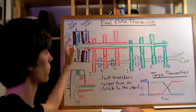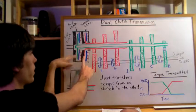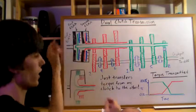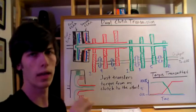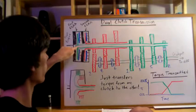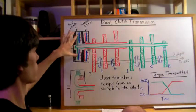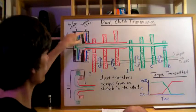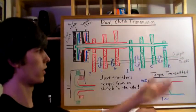All you have to do to switch gears is transfer pressure from one clutch plate to the other. The first pressure plate releases while the second pressure plate engages simultaneously. So one is releasing while the other is engaging, giving a very instant transfer of torque — torque was going down the green shaft to first gear, and then instantaneously it transfers to the red shaft, then to second gear, to the output shaft, and to the differential.